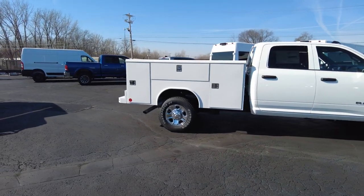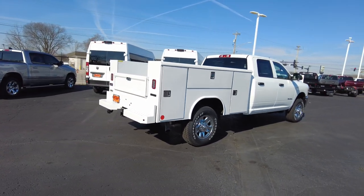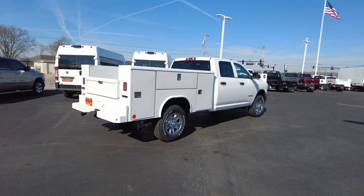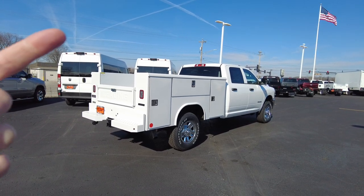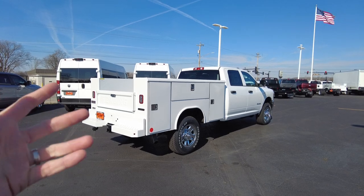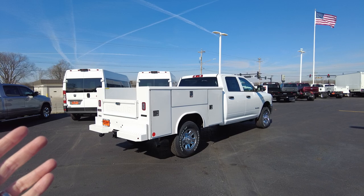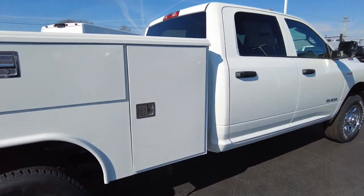The service body is a Redding service body — it's a single wheel service body. We've got a lot of commercial vehicles here and the Redding is kind of the Cadillac of service bodies. This is a Classic Two, which means it's the A60 galvanized steel. You can have aluminum which is good for anti-corrosion but it's not as strong as steel, or you have steel which is really strong but it'll rust. This is kind of a hybrid — galvanized steel that is stronger, can be painted, and has both anti-corrosion properties and the strength of steel. Super great option, probably the best and most popular option out there.